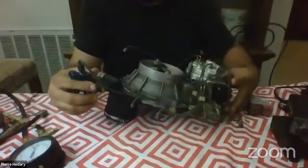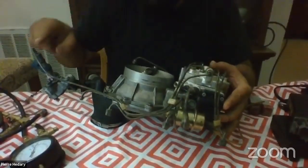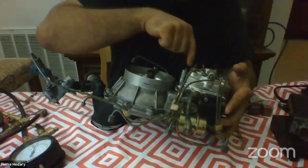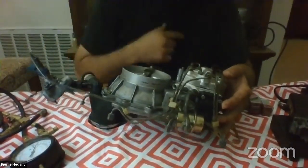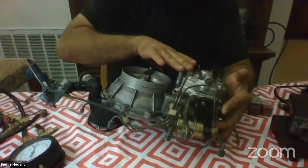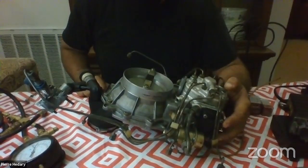Pay close attention to this line — it is not regulated the same as these other lines. This is raw working pressure, directly from your fuel pumps. These eight lines are all regulated with control pressure, which is mitigated by the electro-hydraulic actuator.